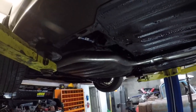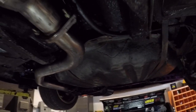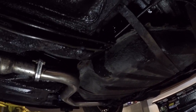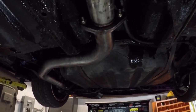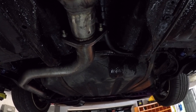You'll definitely be able to see it on the cameras, and on your phone for sure. You might not even have to start it — just prime it. Oh, I heard it. It didn't do it when you first primed it, so that tells me it's the return. Just prime the pump again. It only leaks a little bit that way, so that tells me it's the return line.